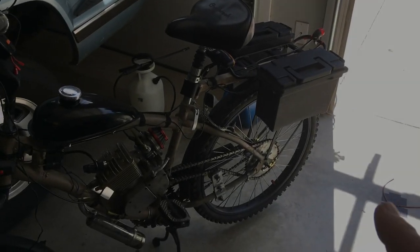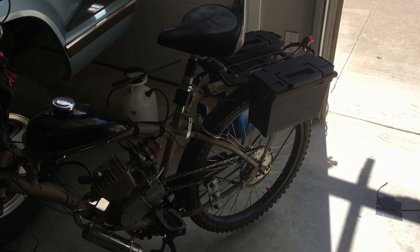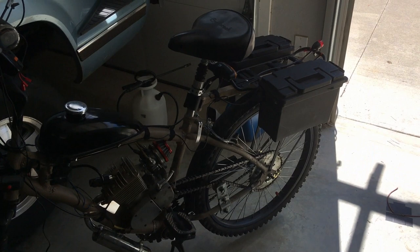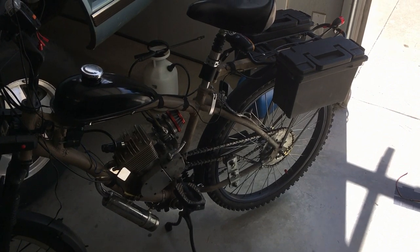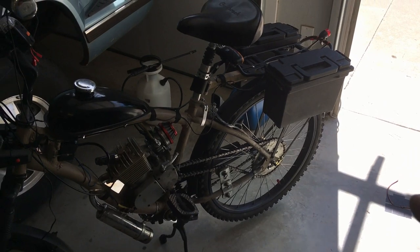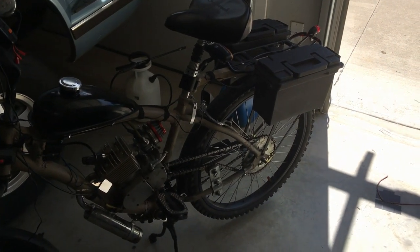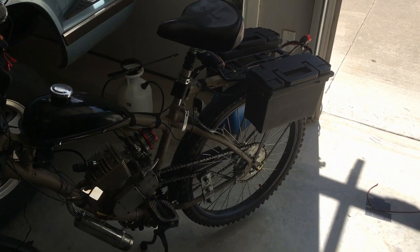What I'm going to do today is a coaster brake delete, and I'm not going to videotape it because there are hundreds of videos on YouTube of guys who do a much better job than I would. I'm just living in fear that the back brake will lock again or snap, and I'm really getting fed up with repairing them all the time. There are also some bent spokes, so we'll remove and replace those, and the tire needs truing too. I got a spoke tool and we'll try to straighten this bike out — that's today's project.